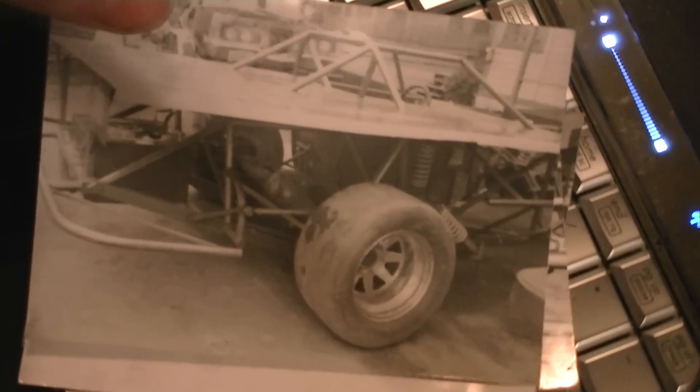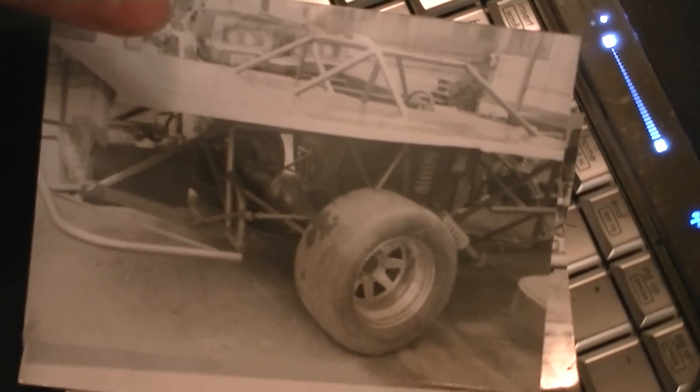Here's a late model with a more conventional front end. With your rack and pinion here, conventional coilovers and upper and lower A-arm. Massive engine setback on this — look at that engine setback. Normal production cars, the centerline of the motor is somewhere around the centerline of the front suspension. Here's the back of that same car. Watts link, torque arm.